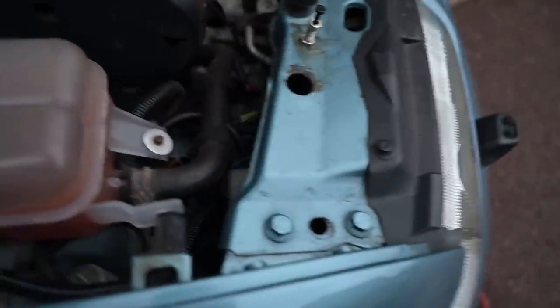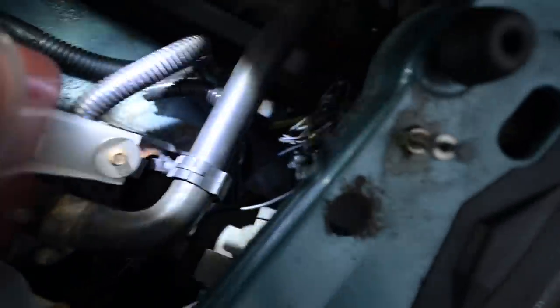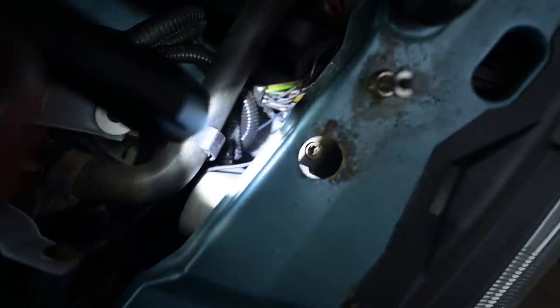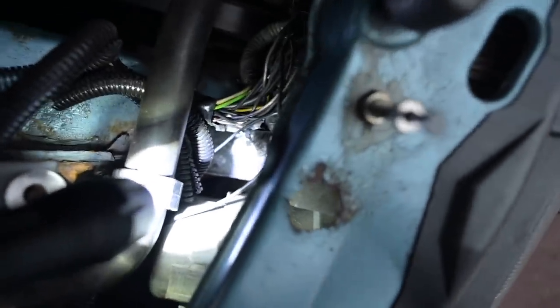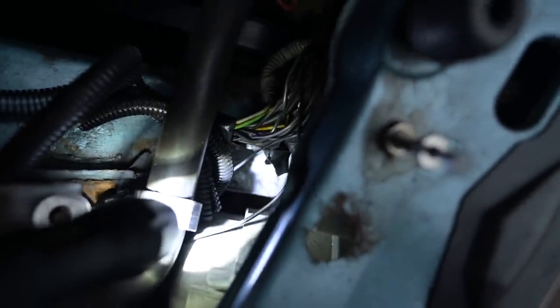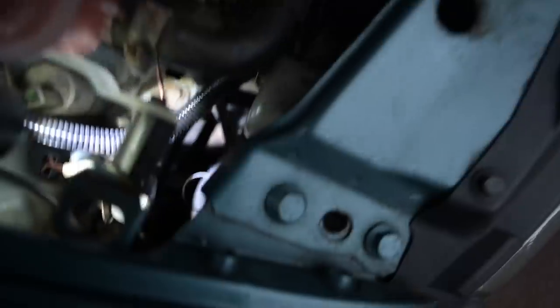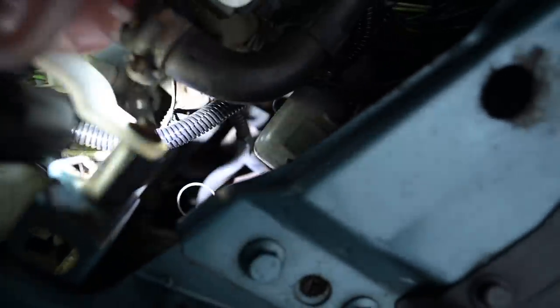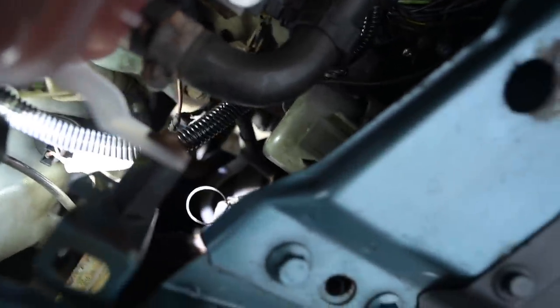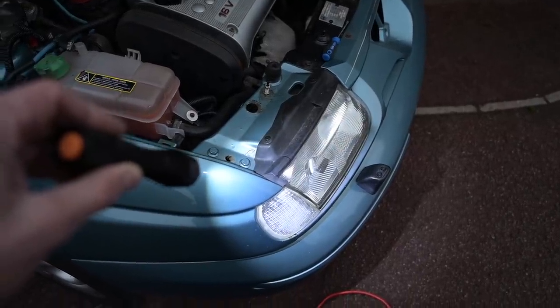What isn't by the by is the fact the horn is not working, and I couldn't figure out where it was. A couple of people commented on the last video — it's down there underneath the headlight. You can see the top of the headlight, the chassis rail, and the bit of metal beneath the chassis rail is the horn. In fact there's one down there as well — there are two horns. Accessing them is going to require actually pulling the headlamp unit out.